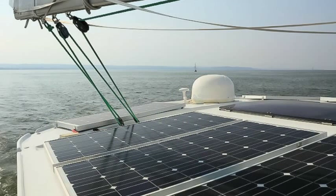Solar is also an option — more as an augmentation unless we have a lot of surface area, but a good way of keeping the battery topped up. Because the engine alternator in an hour of running, by the time the fridge is down, you've made hot water, you've charged the battery, it may have only come up to around 80%. Consistently doing this leaves the battery short-charged, and we're not going to get our full amp-hours. Hence the equation where we say if we're long-distance cruising, we need four times our amp-hour consumption so that we can reliably get that current from a bank that is only at 80–85% full charge.